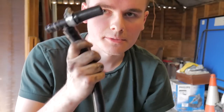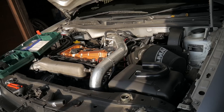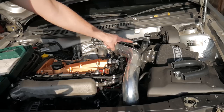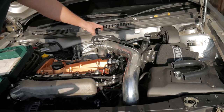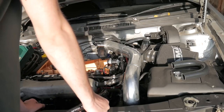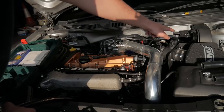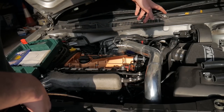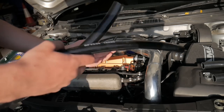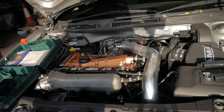The next step is to cut the new hose to shape. I'll show you exactly how the T-piece goes in and which inlet side goes where. The intercooler is really annoying — it squishes up against everything rather than going around like I've seen on other cars. From the crankcase breather, one line goes to the inlet manifold via the T-piece, and the other end of the catch can goes down into the hockey puck. Some people remove the hockey puck but I'm keeping it.